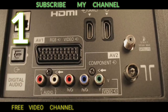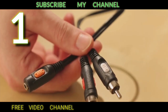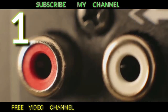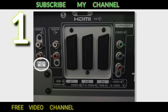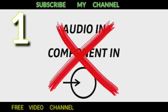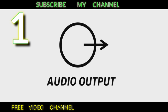A solution for that: if your TV has an RCA output, you can use it with an RCA-to-audio-jack adapter — these don't cost much. On the back of your TV, look for red and white connections. Be aware that ports labeled 'component in', 'audio in', or marked with a circle and an inward arrow cannot be used. What your TV needs is a port that says 'audio out' or 'audio output', usually indicated with a circle and an arrow pointing outward.